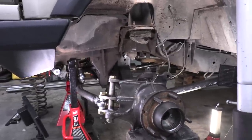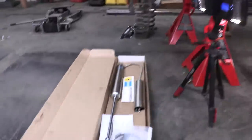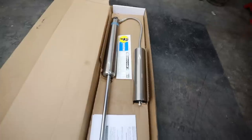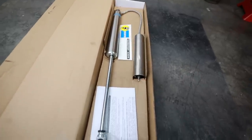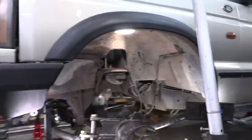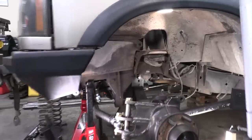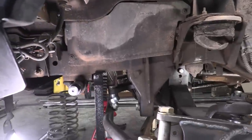There are a lot of builds out there that do limit to 3 inches, but I'd like something a little bit closer to 5. After pulling out the tape measure and taking measurements of our shocks, we have enough room for more than 5 inches — the first thing that's going to contact is going to be our 37-inch tire on the top of our wheel well. So we're going to limit this suspension out to 5 inches, but before we can get there, we're going to have to build a custom pitman arm.